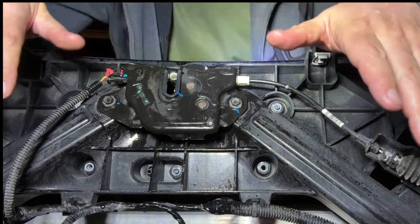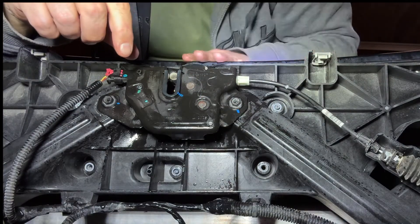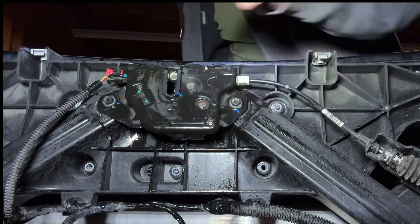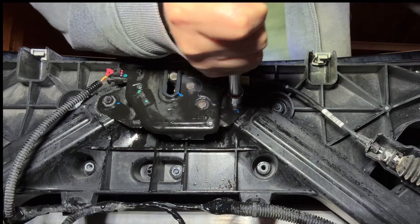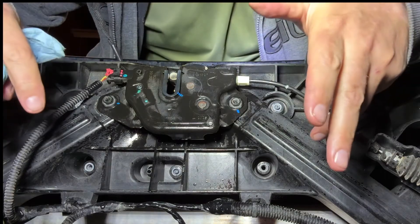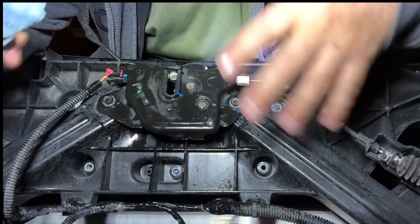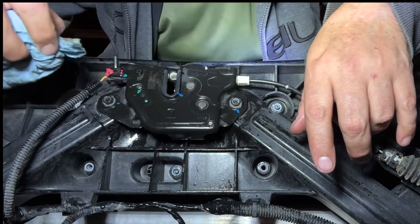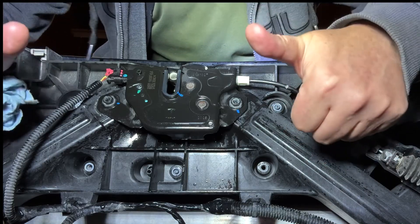And look at that — it worked perfectly! If when you do this the line on your hood doesn't line up, you can move this down and that'll pull your hood down a little bit. So now that I know it's right, we're going to tighten these back up, making sure they've got a little bit of extra tightening. The next step is to put everything back together and put the hood back in — there are like 100 videos online that show you how to do that. Hopefully this helps somebody out and saves you a trip to the service center, or even on a road trip saves you from doing the rest of your trip at 24 kilometers an hour. Take it easy.